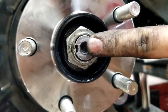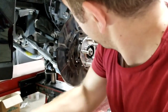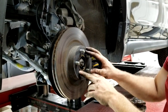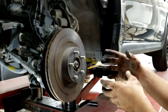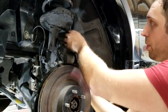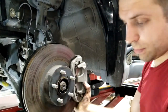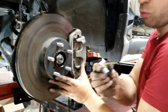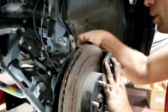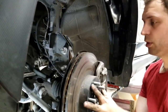That axle nut will never come loose — it's a very important step, make sure you get that done. Next, I'm going to put my rotor back on. Sometimes if the vehicle has some miles, the rotors can stick to the hub and you have to use two bolts to break it free. As you can see, this was the perfect way of putting the caliper away without damaging the brake hose. Now I'm going to put the caliper back on — there are two size 17 bolts on the back, one on top and one on the bottom.